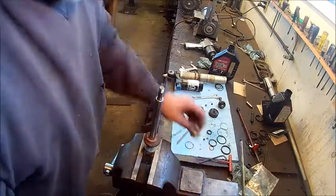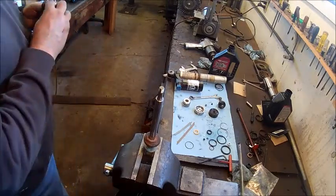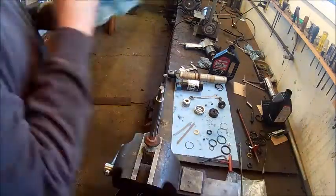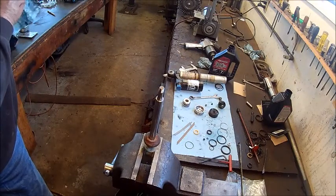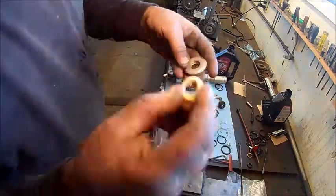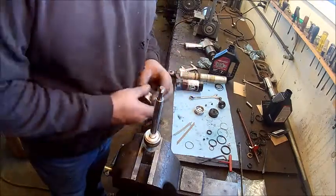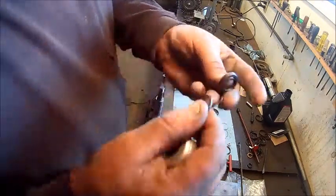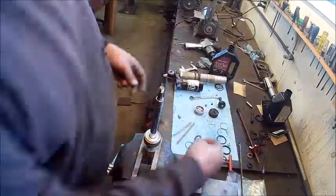And on these there's a removable cap, I guess you'd call it. It has the dirt scraper, or ice scraper if it was a snowmobile shock. On a snowmobile shock, that's all on the gland, so I don't know if it's to keep dirt out a little bit better, maybe. But that goes on, and then there's your gland. It has the pressure seal and a backup washer.